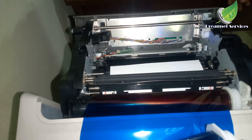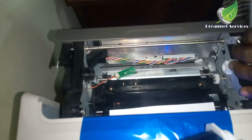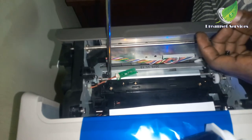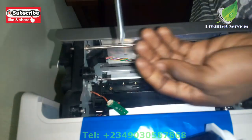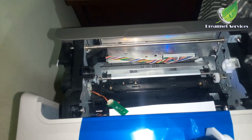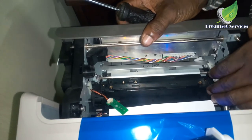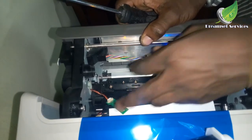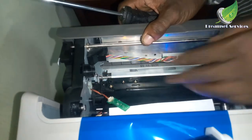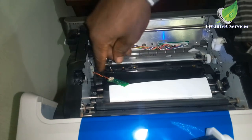Right about this time I have been able to locate where the problem might be from. The problem is likely from the paper sensors. You can see there's a paper sensor on the right-hand side and the left-hand side. I've taken some parts out — you can see this little greenish chip, which is actually the paper sensor. I will remove all the screws holding it down so I can get access to the bottom part of the sensor, where the paper passes through. I want to see what is going on down there — sometimes it might just be a foreign particle or material blocking the movement of the paper.